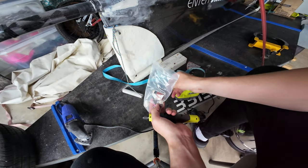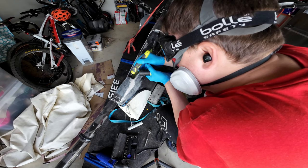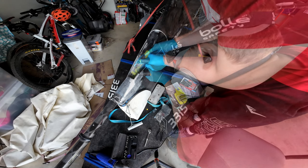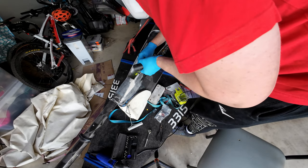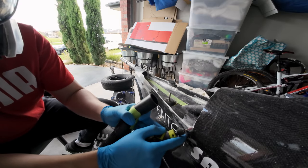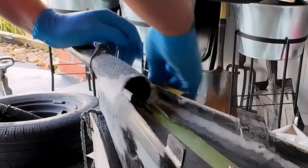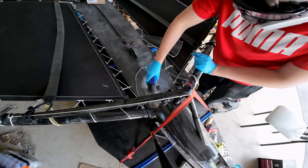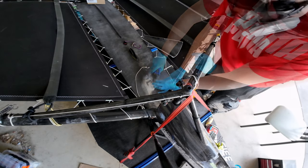In the end, I wasn't happy with the surface finish I got on top of the socket that I'd installed. That blue carbon — I managed to fluff it up when I was sanding it with the $39 multi-tool, and the fibers weren't sitting flat. So I thought best to put bog over the whole thing and sand it back flat again, otherwise when I paint it, it'll look terrible with little bumps all through it and end up looking like sandpaper. So I ended up putting another coat of bog on it, and I think that's where we'll finish up for this episode.